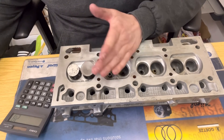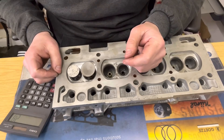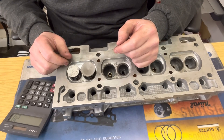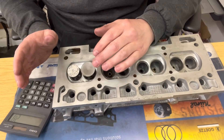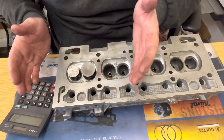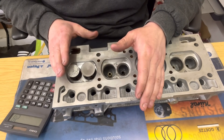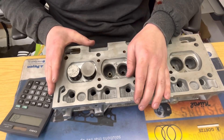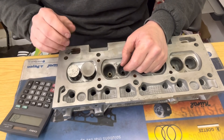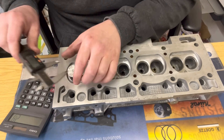I want to go slightly bigger on the inlet because it will give us a bit more torque. I know some of you are going to say I'm talking rubbish, but this has been tried and tested. For example, I did a G40 Polo supercharged — a little 1.3 eight-valve — using Volvo valves with a similar ratio, going slightly bigger on the inlet than the exhaust. We ended up with around 195bhp and about 235 foot-pound of torque, whereas most tuned G40s apparently don't fetch more than about 200 foot-pound. So it was tried and tested and it did work. That confirms our plan: 36.9mm on the inlet and 31mm on the exhaust.